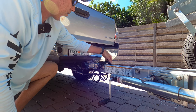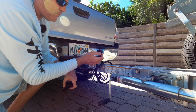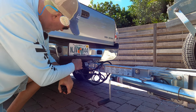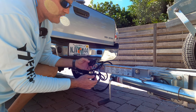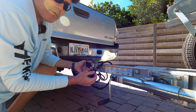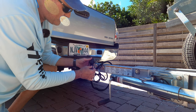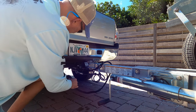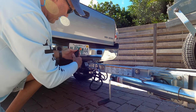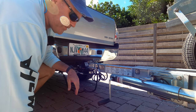The second thing you do is connect the lights. This is the male end from the trailer — you put it into a female end, which you can get at trailer parts stores, marine stores, most hardware stores, or an auto store. You just plug it in, and usually every car or truck has an adapter. Make sure you have enough slack in the cable to allow for turning.